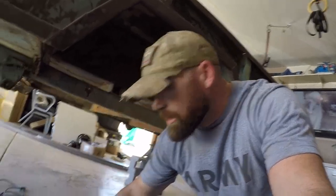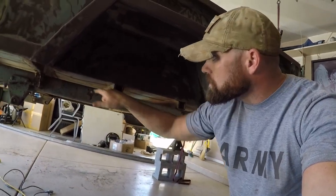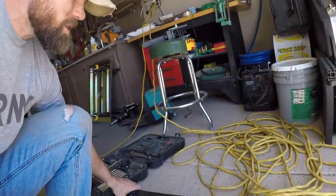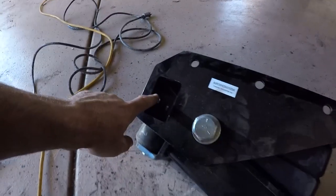So the next step here is getting these. We have three holes here on these axles themselves, and they have to get drilled. We need three holes to be drilled in this frame that then mounts it. But we have to figure out exactly where the center of the tire is going to be in relation to everything to figure out where those holes are going to lie. So then I have the 2x3 steel tube. It's quarter inch thick, 2x3, which is what they recommend as a minimum for the lateral bracing that'll span the actual axle right through here.